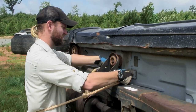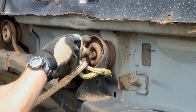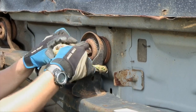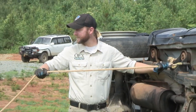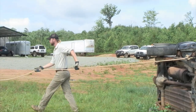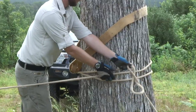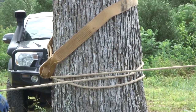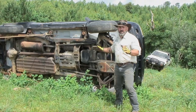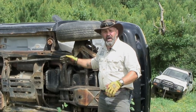Using a synthetic winch line extension, we can come to the frame and tie off to the frame or a hard point on the vehicle to make sure that it's not going to roll. Then come into the closest tree or other safe objects such as another rig that's safely parked and locked down. We can actually tie off the vehicle again just to make sure it's not going to roll any further. Once the vehicle is secured and we feel good about it not going anywhere, we can start into the procedures of how we want to make our connections to get this vehicle back on its wheels.